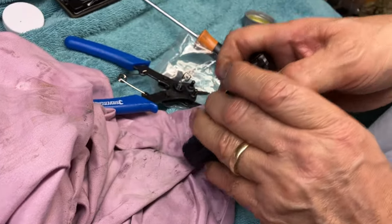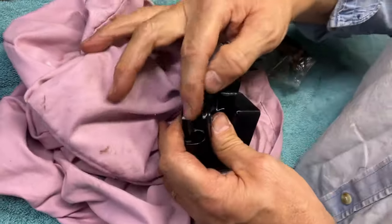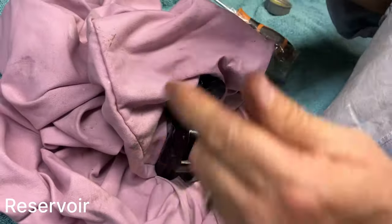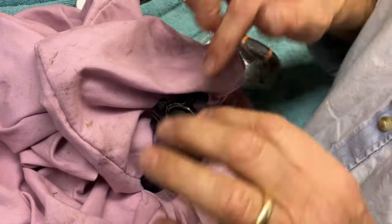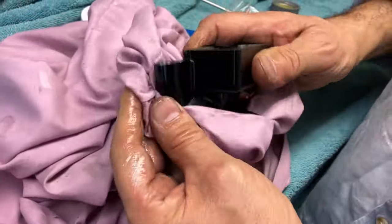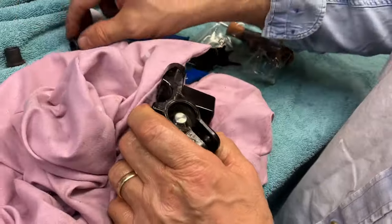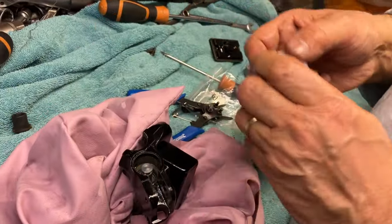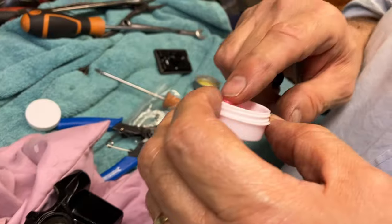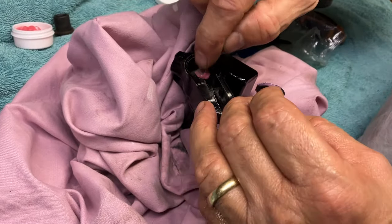So that's basically it - that's going up and down nice and sweetly. Now I'm just going to clean all this off with a little bit of WD-40, but I'm going to make sure it's not going to get anywhere inside the caliper. I'm going to put some WD-40 and then put some grease around and put the dust cap over the end here - just to take the brake fluid off that's on the paintwork as well. Now the new dust cap - it's a grease, smells like furniture polish. I'm going to put some around there, down there, around this.